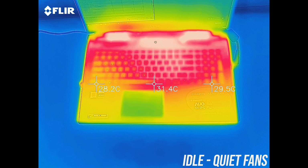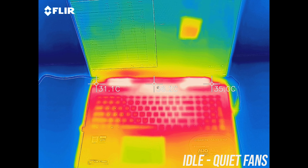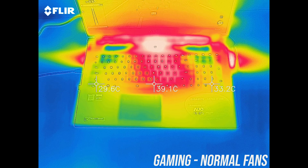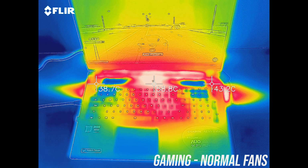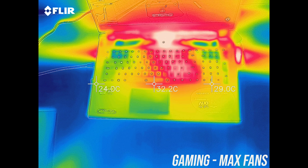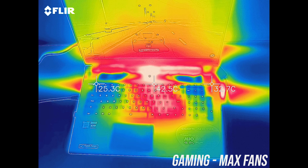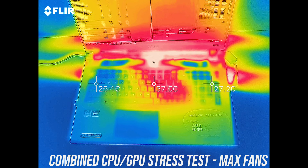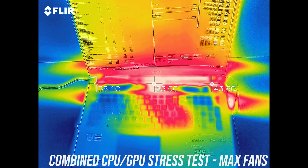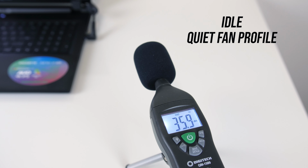As for the external temperatures where you'll actually be putting your hands, at idle it was in the mid-30s in the center, just a little above average. While gaming with the fan on the normal profile, it's getting to the mid-40s in the center, so on the warmer side, and up to 60 right up the back, which was hot to the touch. Simply by setting the fan to maximum speed, the hotspots dropped by around 10 degrees, and the keyboard was much cooler to the touch. Here's what a combined CPU and GPU stress test looks like with the fans at maximum, but this time with the CPU and GPU power limits boosted, and it felt fine due to the fan speed. As for the fan noise produced by the laptop, I'll let you have a listen to some of these tests.